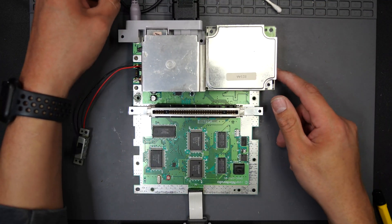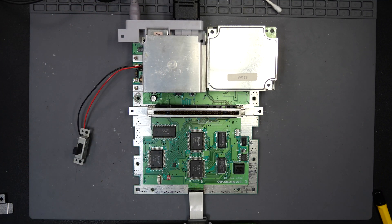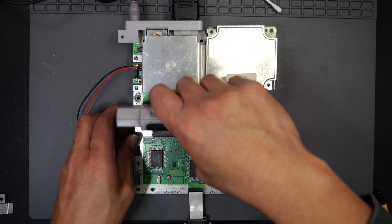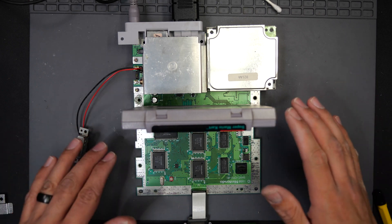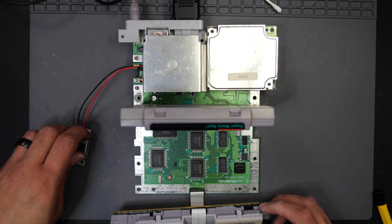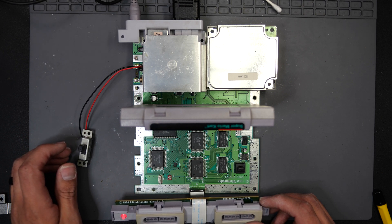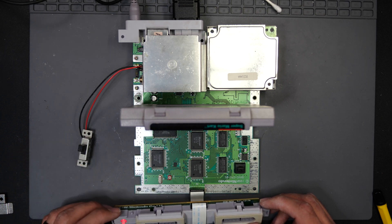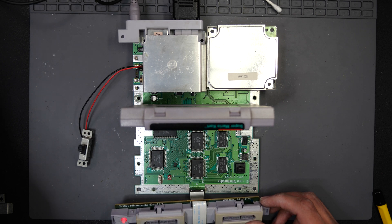His power is a little weird so I might have to end up fixing that as well — I'll show you in a minute. Let's go ahead and just test. You want to be pretty gentle because the board's just sitting like this — you don't want to push too hard on it because it will cause stuff to bust if you put too much pressure on it. All right, power up here — and we got audio back! And it sounds good.